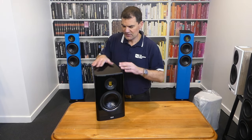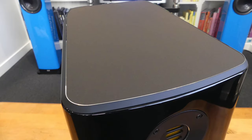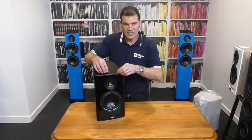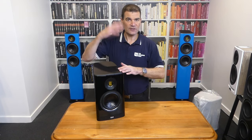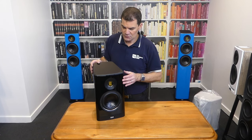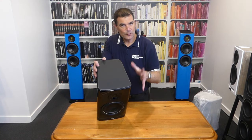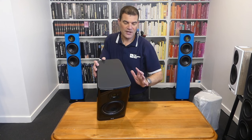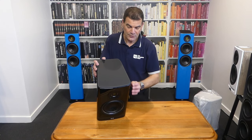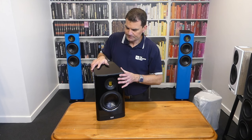At the top of the speaker, we see a reflective or a reflection management panel. Everything, even these little wee edges, are designed to help manage the potential reflection of the main drive units into the space, managing sound stage, but most importantly the direct reflection that can be seen as distortion. The cabinets themselves, and I'll tilt it forward, have a beautiful curve to them. There's no flat surfaces. In fact, the almost wing-shaped design must be incredibly expensive for them to produce. And yet they do so because of the respect for the engineering behind something of this credibility and quality.